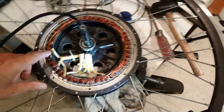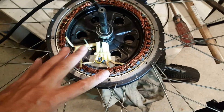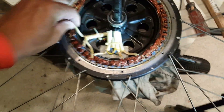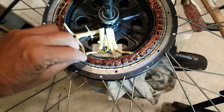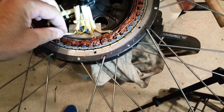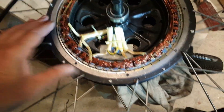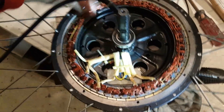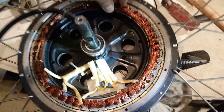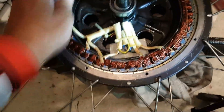So what we're looking for is our three phase wires and our sensor wires. We want to make sure that everything is nice and tight. Going in there, this looks really solid — all of these are really solid. This is zip-tied, these are soldered correctly, and there are absolutely no loose fittings. That's really important. You want to make sure everything is nice and tight in there, and then go around and check that the copper bindings are tight too. There are a few loose wires — just push them back.